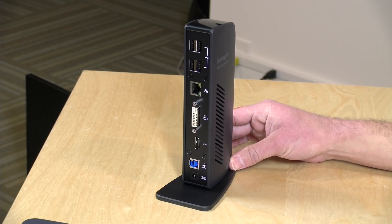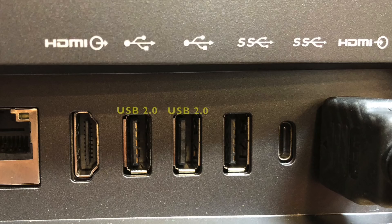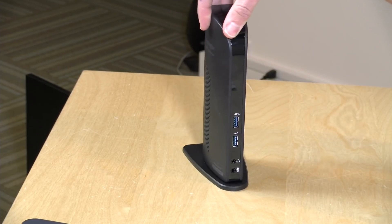It's not a direct connection like you'll get on Thunderbolt or USB Type-C, so make sure you have the dock plugged into a USB 3 port on your computer. Usually those ports are blue in color like we saw on the laptop earlier, but in some cases they don't change the color and you have to look at the label silk-screened onto the computer itself. For example, I recently reviewed a computer that has USB 2.0 ports right next to USB 3.0 ports — they're the same color, but the USB 3 port has a little 'SS' next to its USB icon in the silk screening, and that's how you know it's a USB 3 port. If you're plugged into a slower port, you might see issues with video output and other things may not work as fast as expected.